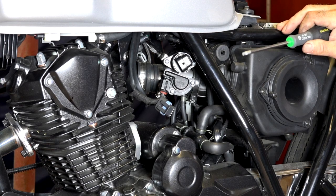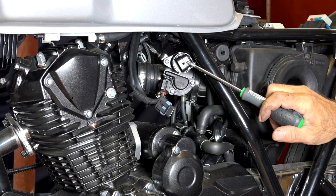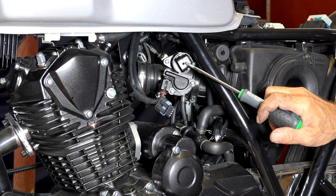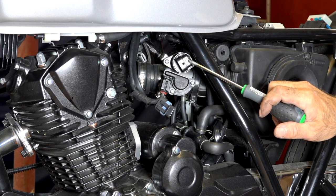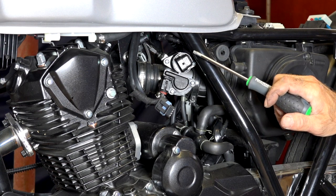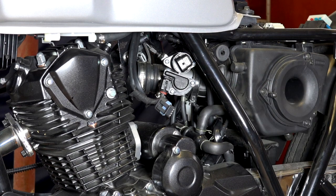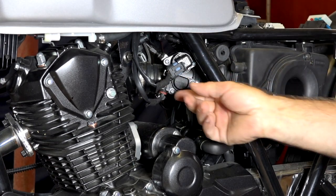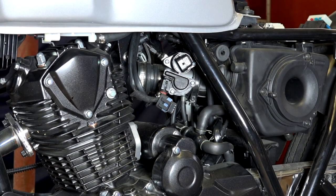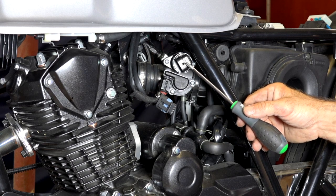On the left-hand side of the intake manifold we find two sensors. The top one is actually a controller — the idle solenoid. This device controls the idle running of your engine based on signals from the ECU. So if your engine is not running well at idle, maybe the idle solenoid is not working anymore and you may have to replace this unit.